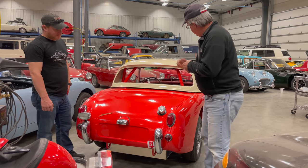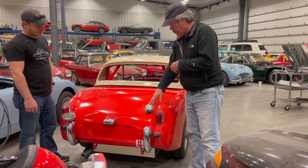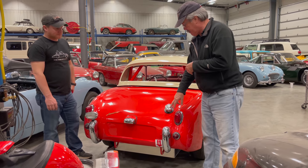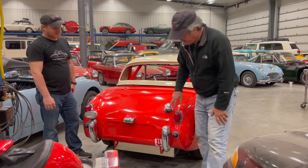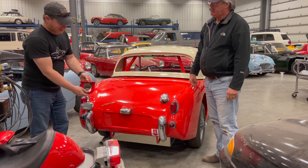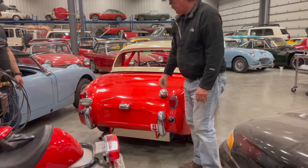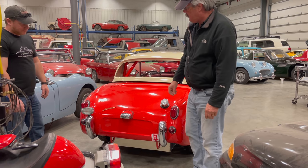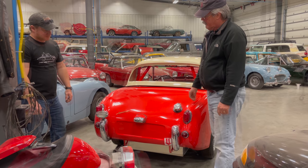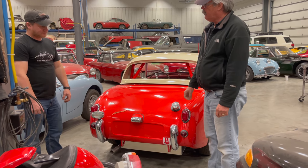At the back of the car you can see the roll cage more clearly. We've got a quick-release fuel filler going down to a mandated fuel cell — the cap is wired shut per modern safety convention. We have tow eyes in the rear as well, required to meet FIA rules. That's a Fuel Safe cell built to fit the car. We've got an original Lucas 494 reverse light. Eventually we've talked about going to the twin pipe exhaust system, as was used on the 1959 Sebring race cars.